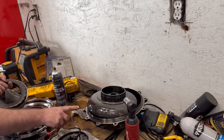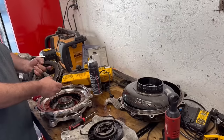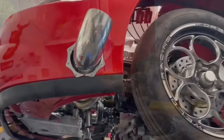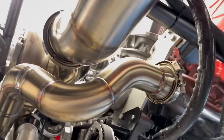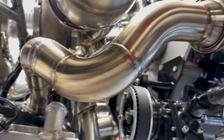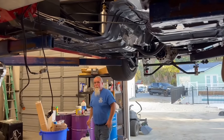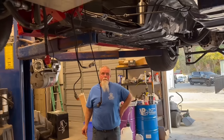In a normal non-lockup converter the stator freewheels — that's why it spooled better with the old one. Brandon, who you see on Courtney's channel Paint and Paper Hustle, remade the outlet from three-inch pipe down to two-and-a-half inch on this coyote motor, and it helped tremendously. It went from getting hung at 32–34 PSI to going up like it did with nitrous.